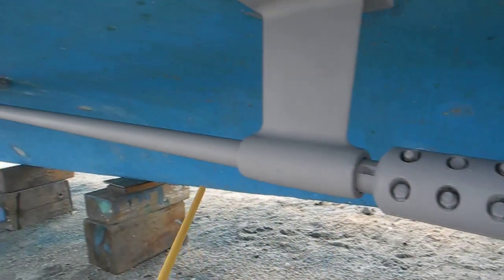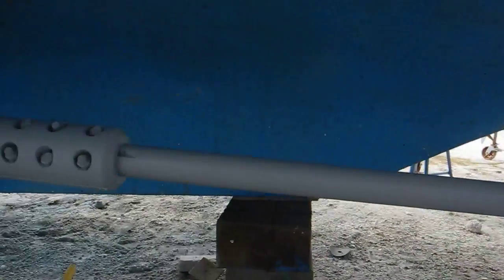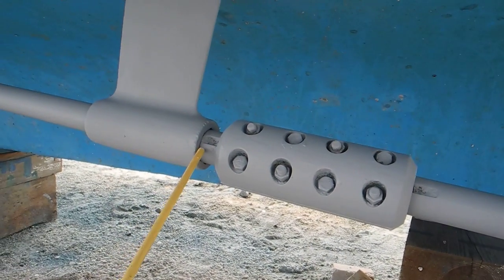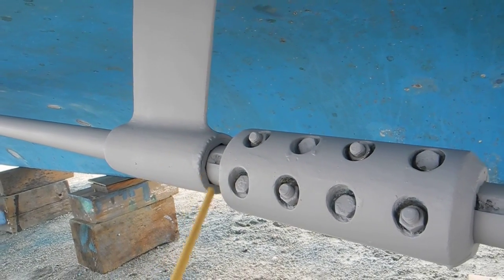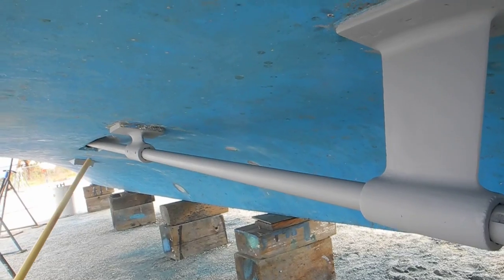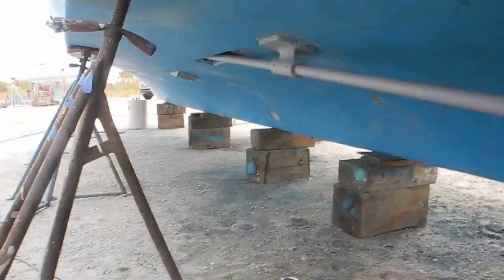The shaft is so long that it's really not a one-piece shaft but a two-piece shaft. This is the coupler — that's the after shaft and that's the forward shaft with an eye strut, and there's another brand new cutless bearing installed in here. Then look up there — you can see the forward strut. There are three struts on this boat and a new cutless bearing installed in that one also.